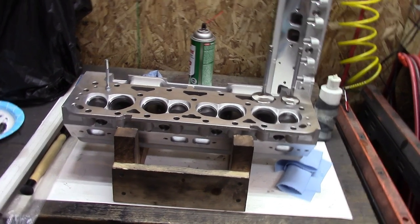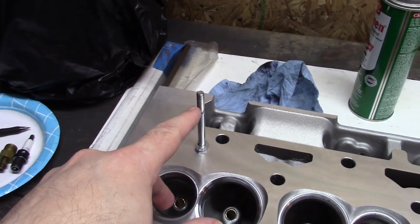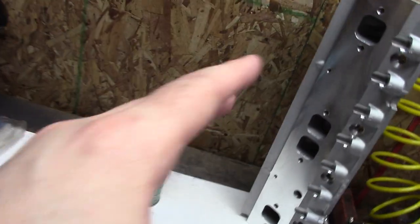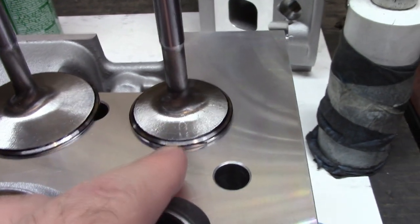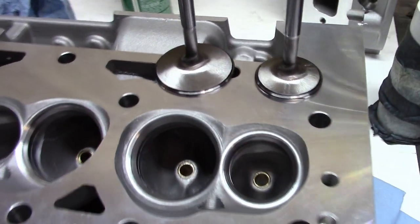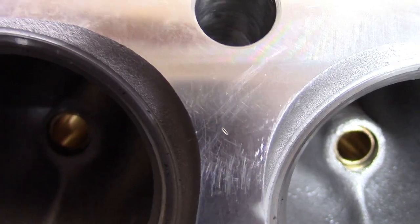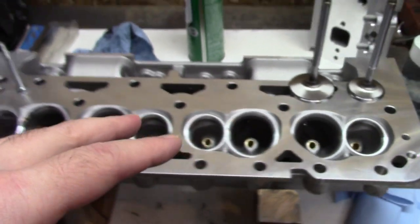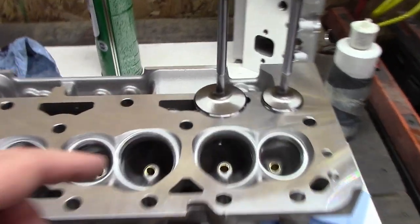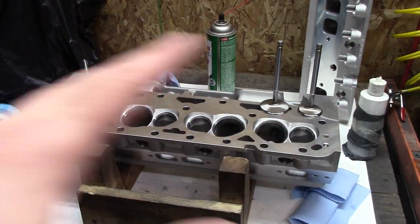First head checks: all good — well, 99%. There's a couple small defects. On the other side there's one quarter-inch thread that needs to be fixed. It's for the center bolt valve cover, which I don't really care about — I'll chase it down and fix it, no problem. The seats checked out good, the exhaust right where it should be, the deck is flat, no odd spots on either end. There is one little spot with some light scratches, I'm not really stoked on it, but it's very light. I don't think that'll be an issue with the head gasket, but I might smear a little bit of copper coat right here just to be safe. All threads check out and this head is good.